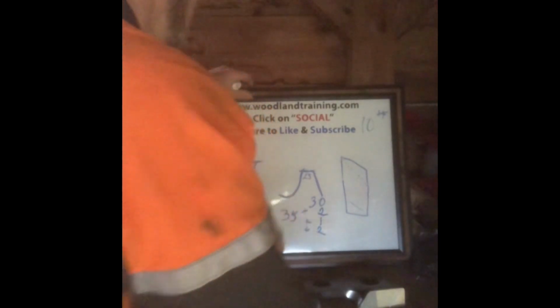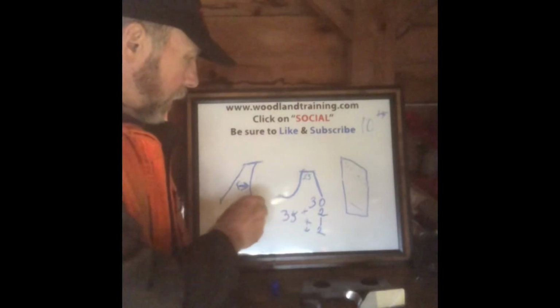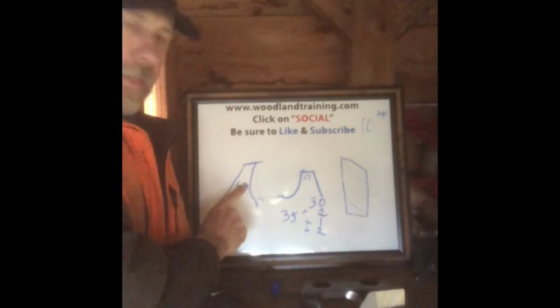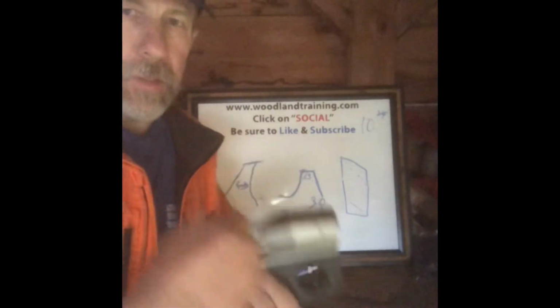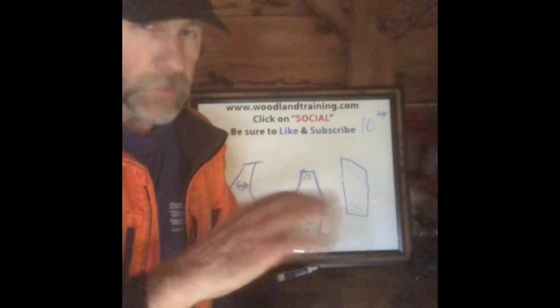So there's what would be left of the tooth if we've round filed. What happens here is back on the side plate, this area of your side plate is going to become so weak that your top plates will start snapping off. So that's not good.